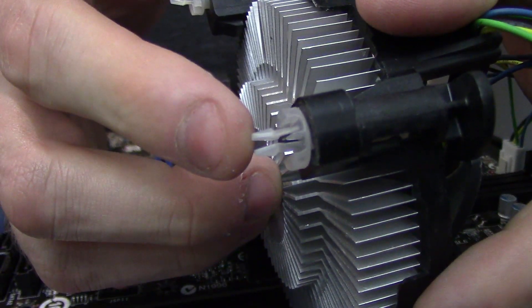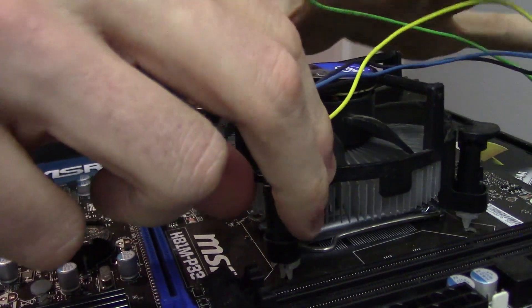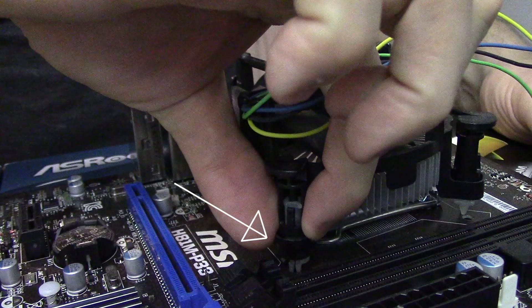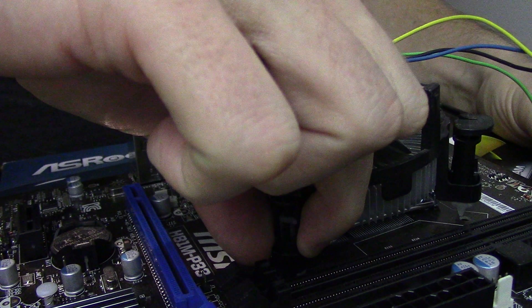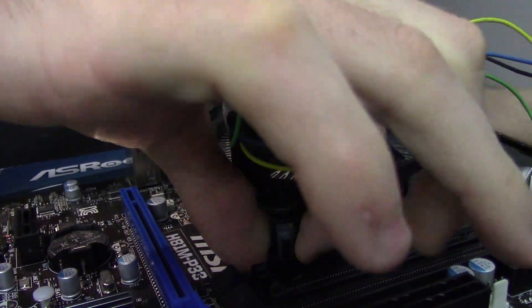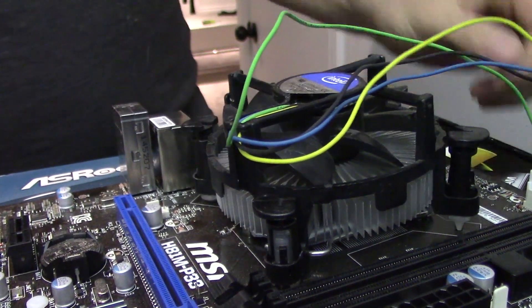To avoid this problem, do the following. Step 1: turn the desired latching peg to the right. Step 2: grip the black cylinder surrounding the movable shaft with your index finger and thumb, and line the mechanism up with the corresponding motherboard hole. Step 3: press the white barbs down into the hole until the hilt of the mechanism is flush with the board. Step 4: from above, use a third finger to press the black peg into place, which should in turn separate the white barbs and secure the mechanism.